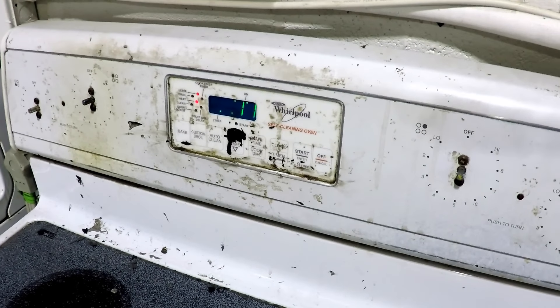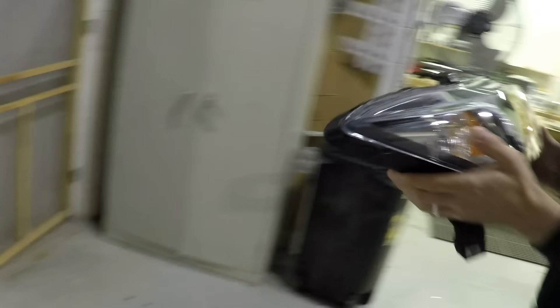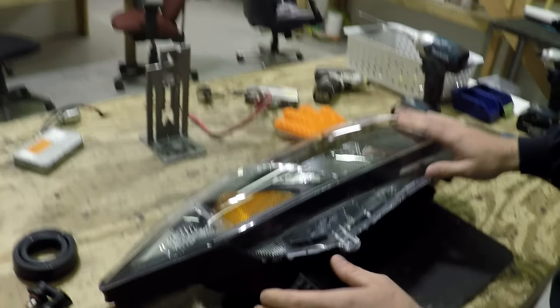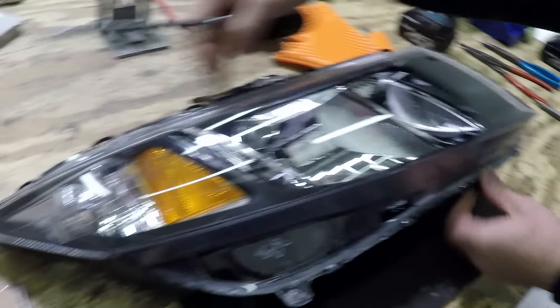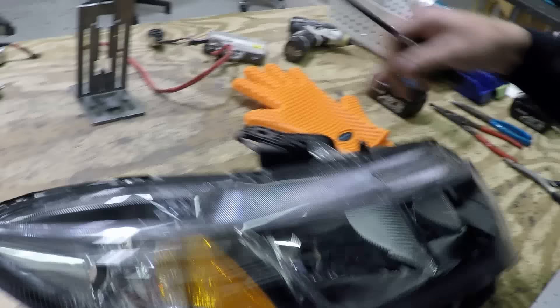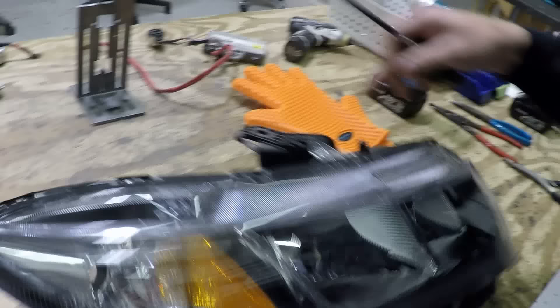The light's about to come out of the oven. One thing I did not discuss was time and temperature. You saw my oven was set at 240 degrees. You're going to see a lot of different things on the internet — some people do 275, some people do 200 degrees Fahrenheit. We do 240 degrees for everything, and we're always baking for 20 minutes at a time. I like to go the low and slow method. Other people do a higher temperature, maybe 275 for seven minutes. Being at a lower temperature is always going to be safer when it comes to deforming or melting anything. It's always safer to go lower, but you can't go too low — you don't want to be at 190-200 because then you're going to need a lot more prying force and you're going to chew up the housing.